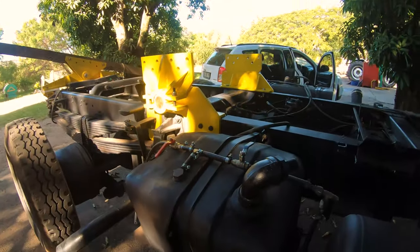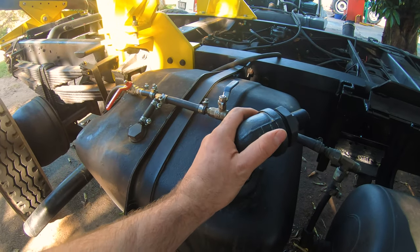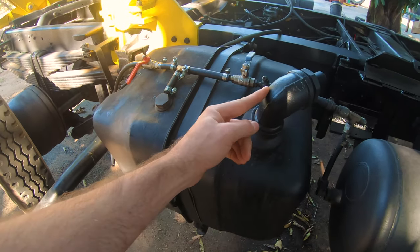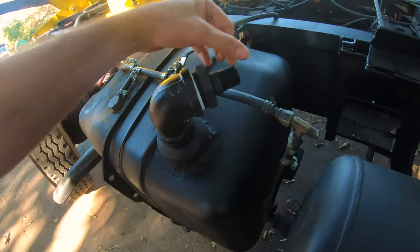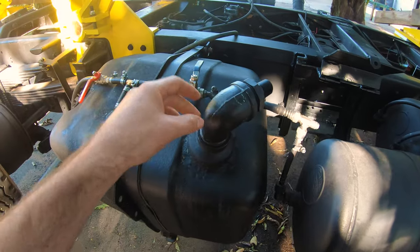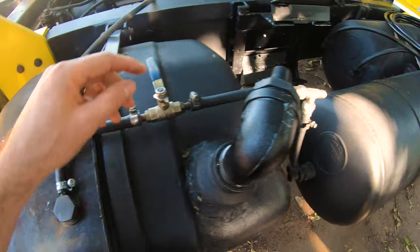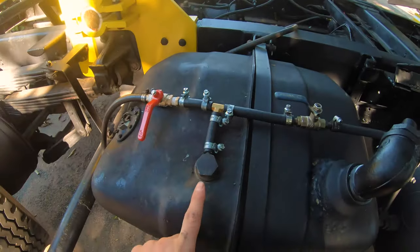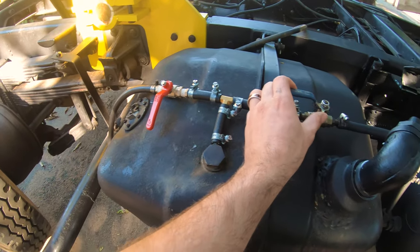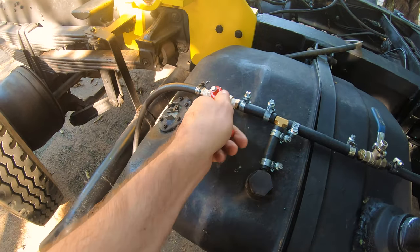Yesterday, to film it, Pugs and Yolandi sorted the system out for us. It wasn't working great. The plastic fitting kept breaking. When we installed it, we were working with what we had, so we replaced that with a galvanized elbow, so that'll be a lot stronger. That connects straight to the pump. The pump can lock up like that. We've lost our air valve over there, the release valve. Installed it over there. We'll fill up with the tank. This will be open, and that'll be closed. The air will go into the tank, sending the oil through to the other tank. When we're done, close this valve off and open this one to release the excess air.